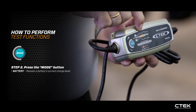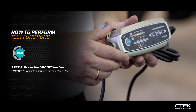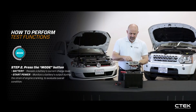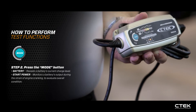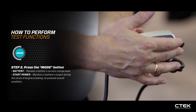The battery test comes up with a result — this one shows red. If we're in a vehicle, we can proceed to the starter test. Press the mode button, crank the engine, and the tester will come back with a decision. This one is showing green; it hasn't seen an actual volt drop because it hasn't seen the starter in action.